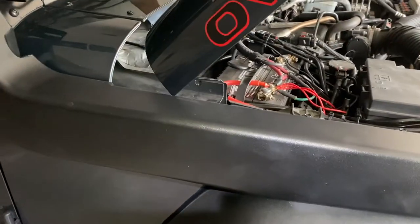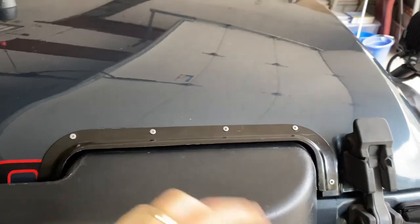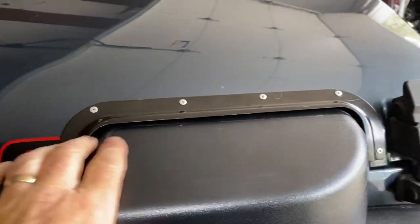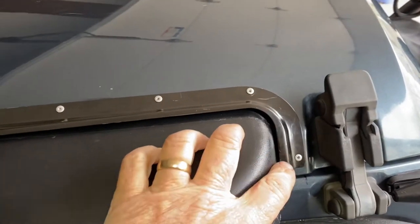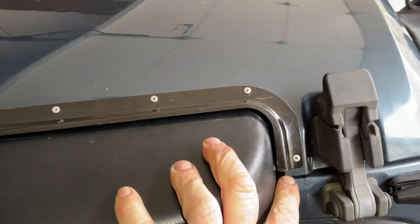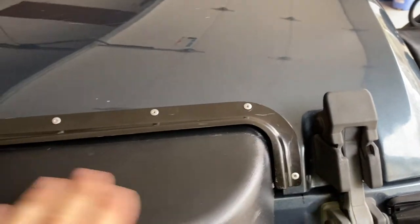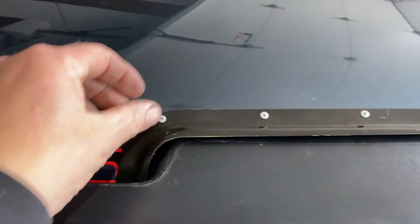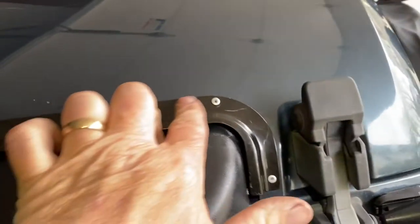Here's what it looks like when it's closed and installed. Another quick tip: after you put the bezel on, before you pop rivet it, close the hood, lock the latches, make sure it's all even, and bolt it up tight. You want a nice even gap all the way along. This one was up a little bit — if I had set it flush like they said it would be hitting — so you just adjust it. I raised it a little, put one pop rivet, adjusted until I liked it, put one more, made sure it was even, then put the rest in.